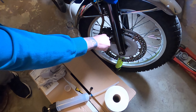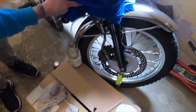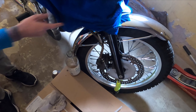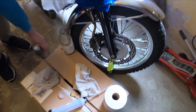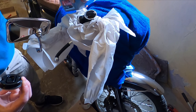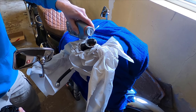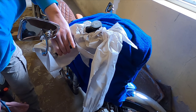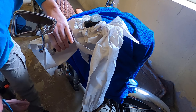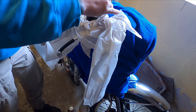Just keep doing this until the fluid gets past the one-way valve on the hose. Once that point is reached, you can just pump the brake lever continuously. Don't forget to check the container and fill up with new brake fluid so you don't run dry, because then you'd have to bleed through the system again to get all the air bubbles out. Repeat: pump out old fluid, check the reservoir, fill up with new brake fluid, and continue.